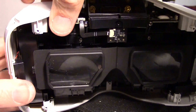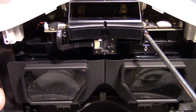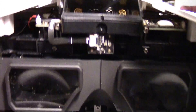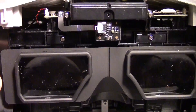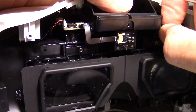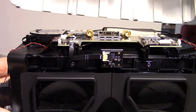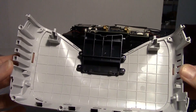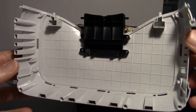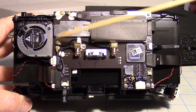This top is going to have to come off first because there are some screws down here into the bottom section. I'm going to have to remove these two screws because this black piece is screwed to the top where the hinge assembly goes in. I can already feel it loosening up, and there it is - comes off easy. No wires attached to it at all. It just has this black plastic cover that went over where the hinge plugs in. This is the button here to release the hinge - that's all it does.